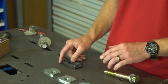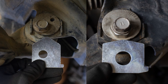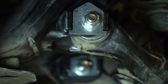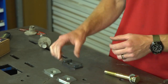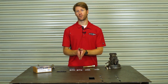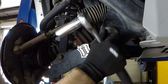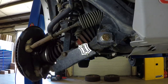There's a real easy way to install this kit: you index off of what your alignment settings currently are. A real common setup with these Toyotas is to maximize the rear cam to the outboard position. The fronts a lot of times end up right in the center. So you can baseline off of what's already set on the vehicle, swap these in, then just get your toe reset and you're more or less good to go.